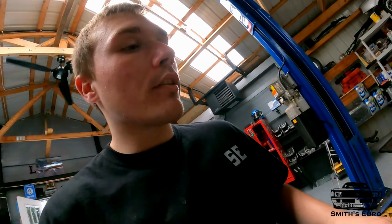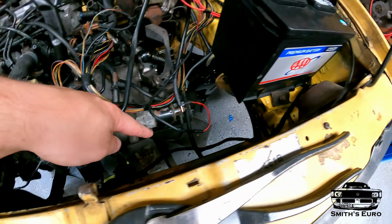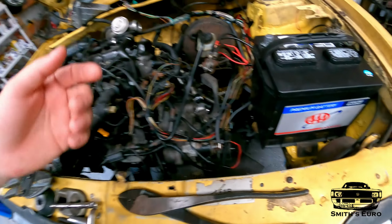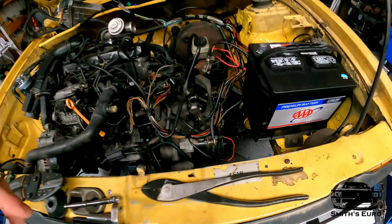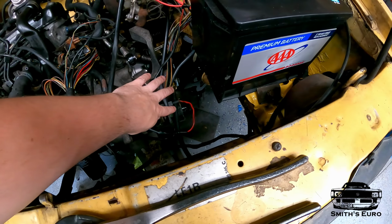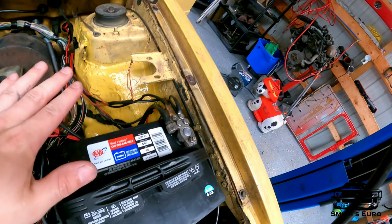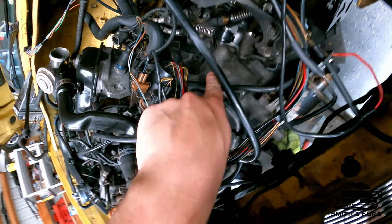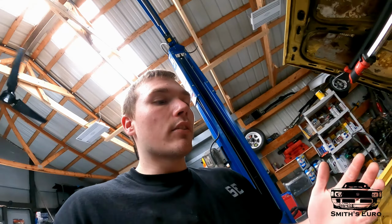I did use the Mark III alternator wiring. So that comes right over down, back to the starter. The Mark III positive was a little bit too long. So I did cut it about, I don't know, maybe 7 inches, and then put an end on it, heat shrunk it, put it on there, all that's good to go. And then with the ground, I left it as it was, so it comes all the way down and around, right to the transmission bolt with a stud right there. So that's as it is, OEM.